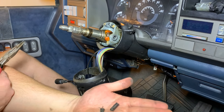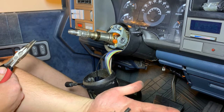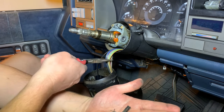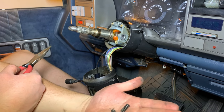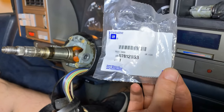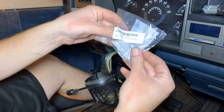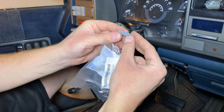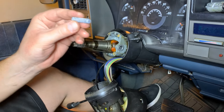We've got a new spring — we'll show you the part numbers before we slide it in, and then we're going to start the reassembly process, also replacing the turn signal switch in that process. We've got a brand new spring here and the part number is shown there — that will be our gear lever return spring.